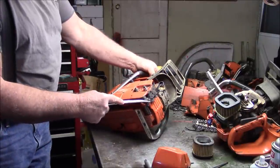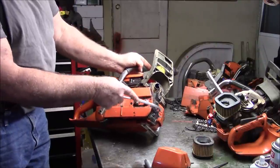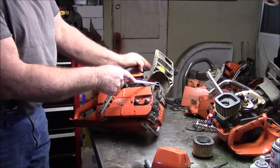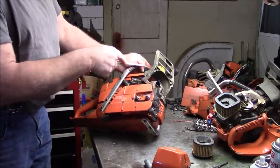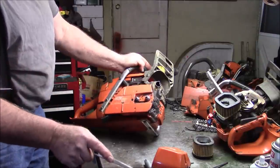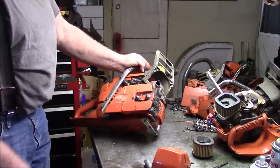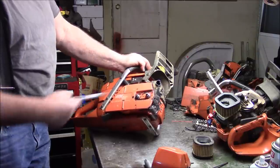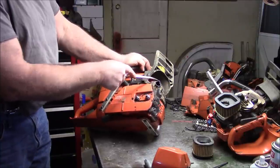I noticed this got bent a little bit, and I noticed he dinged the muffler mod. By the way, if you swing an arc up through here, how you roll a saw into a tree, when you do your muffler mods, you've got to take that into account. I usually do. This one here I didn't, which is why I like to exit over here, so that when he rolls it in, he does big trees. Nothing this guy does is small. It's not, you know, cants like you see these guys doing with cookies. He cuts big trees. He bore cuts all of them, Game of Logging style. So this saw is buried into the tree all the time. So I'm going to bend that out or grind it out, straighten this thing up.